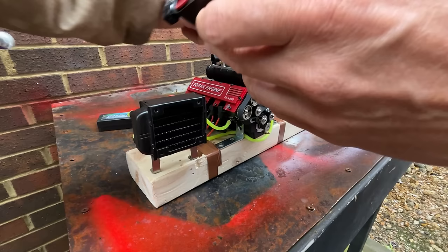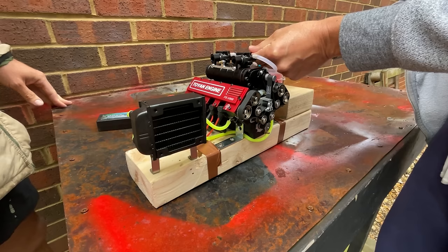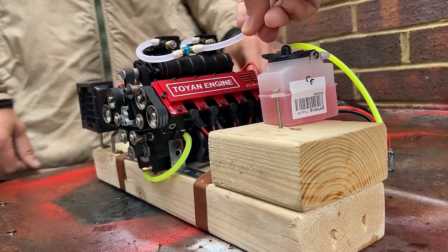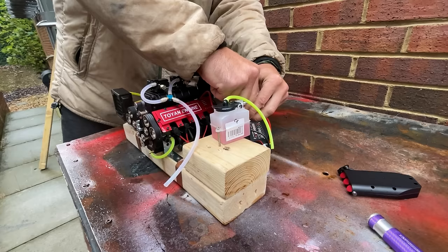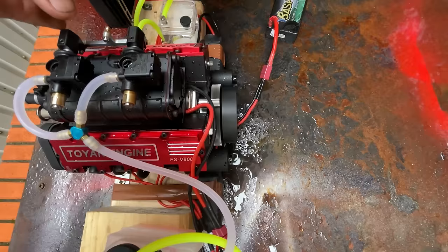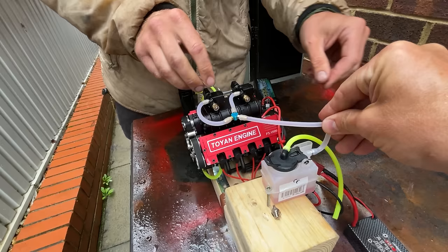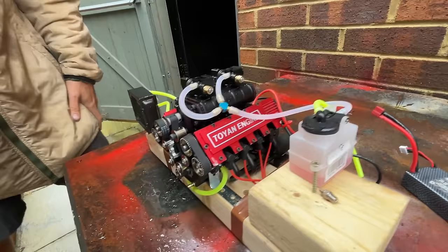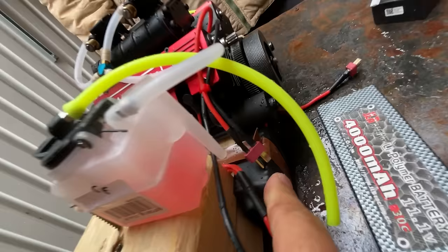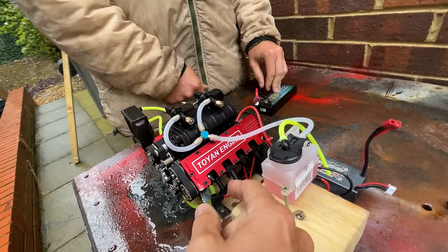So I'm pretty sure the top of the engine is just there for show. To make it easier to mess about with the settings on the carburetors, we've just removed it for now. It's very difficult to figure out if this engine is running rich or lean - rich means too much fuel, lean means not enough fuel. I think we've flooded the engine, so I've temporarily disconnected the fuel lines, turning it over a few times to get all the excess fuel out and then try again. We've tried so many different mixture settings - tried lean, tried rich. The only time it tries to start is if it's running rich. It's spitting fuel out the breather and loads of fuel out the exhaust. It's got no startage, so I don't know what's going on. We're going to try a flush carburetor setting. These engines can be a bit temperamental to get going, but hopefully once we get it going it's going to run well. The glow plugs aren't firing anymore, so I think we need to check those - we've removed one and holding it on the engine, and we have no glow.